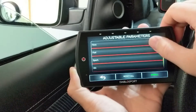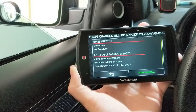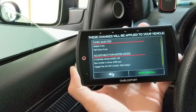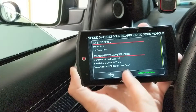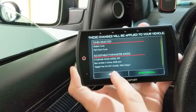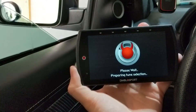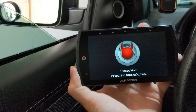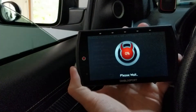Those are your options for changing stuff, so I'm going to go ahead and install it. Installing the Diablo tune — yes, that's your 93 octane tune. Performance transmission tune — yep. 4-cylinder mode off, rev limiter 6700, and your fan temperature on at 185.6 degrees. Accept and install. Now it's going to have me either turn the car on or off multiple times throughout that process.